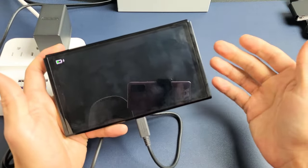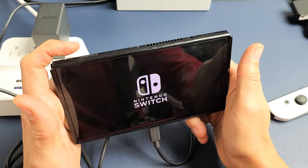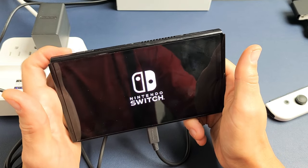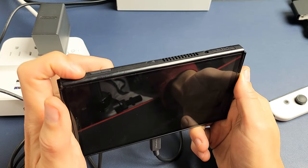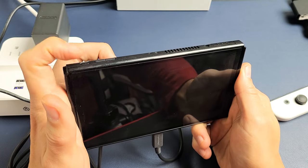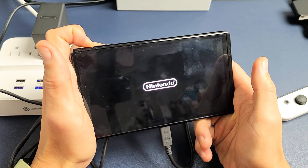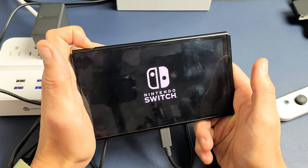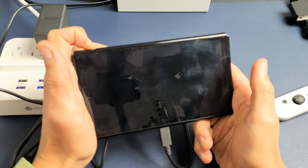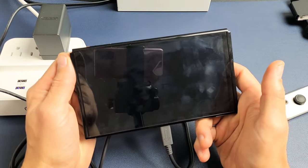It's possible that your Nintendo Switch could be totally dead with no battery juice. If that's the case, you may have to wait five or ten minutes before you try the next step. While it's plugged in, we're going to do the same thing — press the power button and keep holding for fifteen seconds. Then go ahead and let go, and now just tap the power button once and see if it boots up.